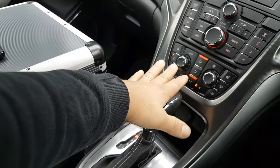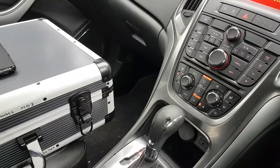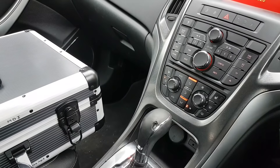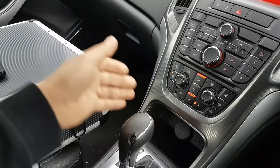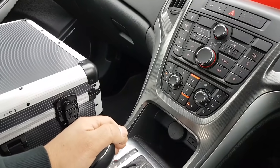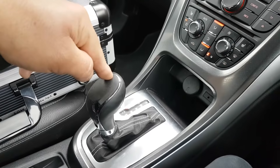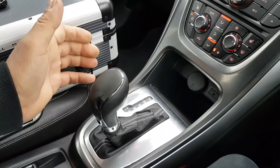I haven't moved the gear lever yet. I'm not going to do a fresh reset of the learning procedures because during the software update that's most likely all wiped out anyway. I'm very suspicious that the software update will have done anything - but let's try. Moving to Reverse as normal, and then Drive. Oh - it actually made a difference! Really! That said, it was intermittent before - sometimes it would do it, sometimes not. I'm going for a drive. It's engaging absolutely perfectly.